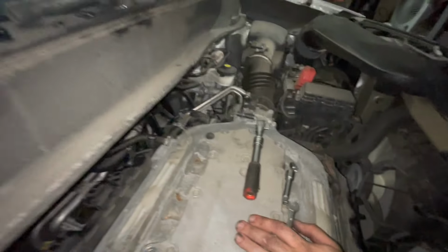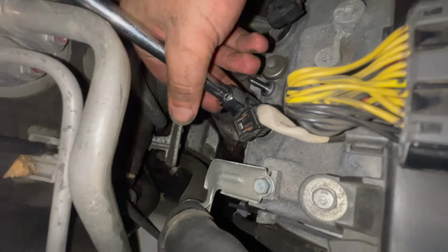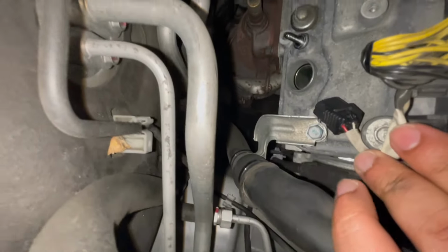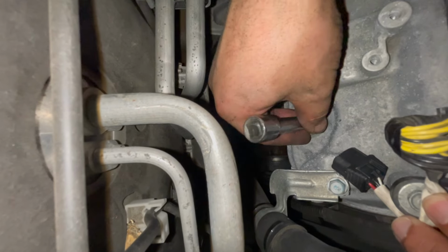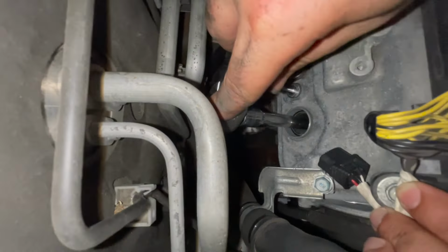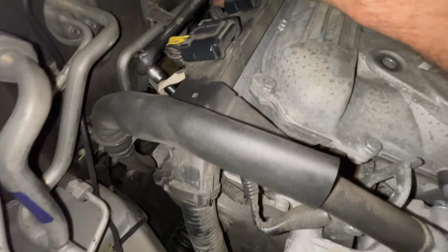And then, now the next step is to go ahead and try to get our wrench and socket in there to pull the plug up. All right, now we're gonna go back in to each tube here. Gonna have to fight with it. Probably gonna go ahead and pull the socket off first and then drop it in there because there's not really much room in there. Then I get to stick the extension in there. Okay, now we're gonna go ahead and loosen it up. Might be helpful to have an extendable ratchet on this one because these are tight.